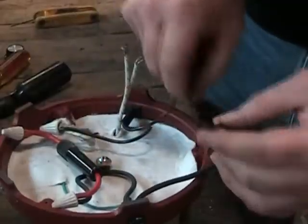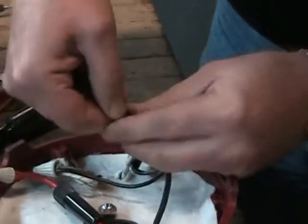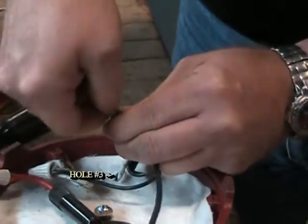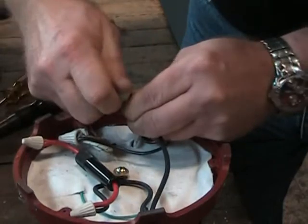And now we will take the remaining run light and power cord leads and join them together with the second pair of heating element leads located in hole number three, twisting these four wires together and adding the final ceramic wire nut and tightening until it is snug.